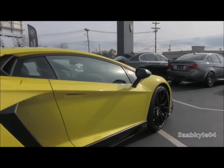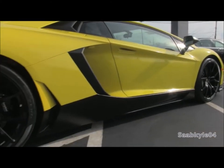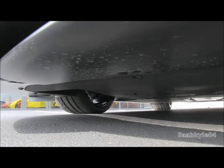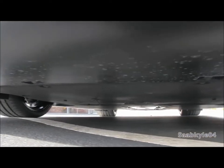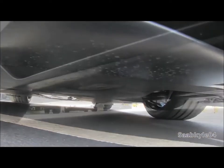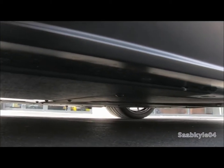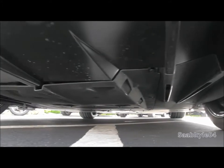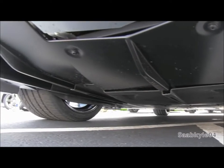One large benefit is the reduction of unsprung mass, which includes everything not supported by the springs. By relocating the shocks and springs inboard of the chassis, horizontal rather than vertical, the unsprung mass halts at the pushrod. It sounds complicated and there's a whole lot going on, but with the Aventador's low profile, it frees up a lot of room for the drive axles and allows more air to pass through.